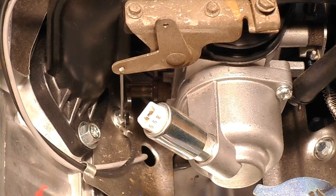These motors — I've got a lot of experience with them — they won't run until they get warm. They need to sit there on full choke for about 12 to 18 seconds. You can start backing that choke off at that point, but at idling speed it usually takes about a minute and a half to get fully off choke and have the engine stay alive with cold air coming into it and be able to ask for power out of the motor without it dying.